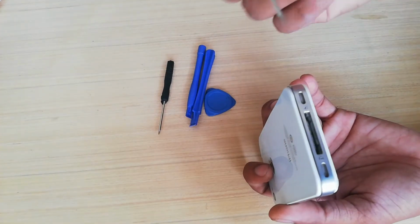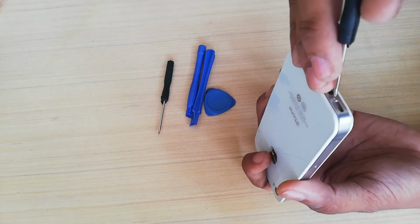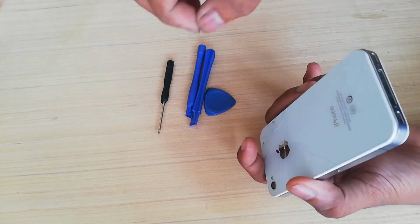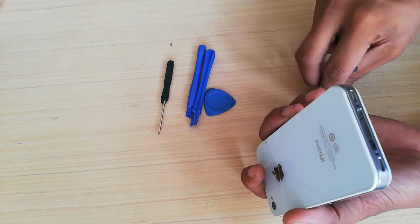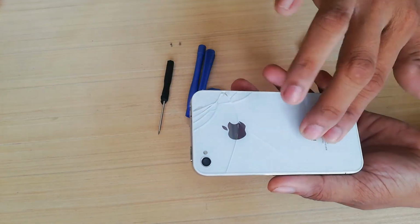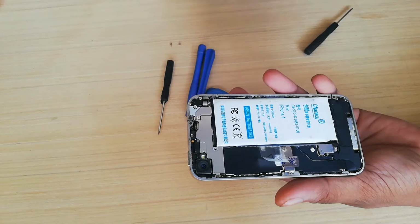After you turn off your phone, unscrew these 2 screws near the USB charging port. Be careful and make sure you insert the tip of your tool before twisting to open or loosen the screw, to make sure it won't break the screw's grip mold. Now, tap the back cover and slide it up. Before lifting and removing the back cover, do it carefully.